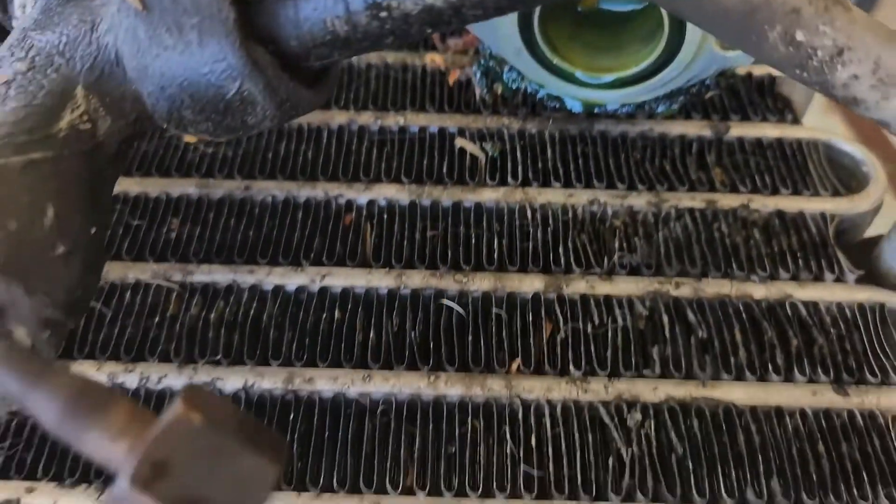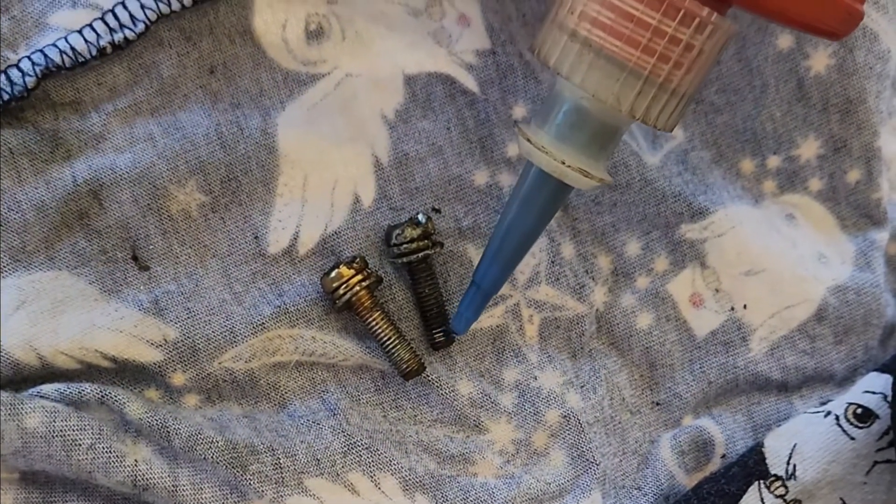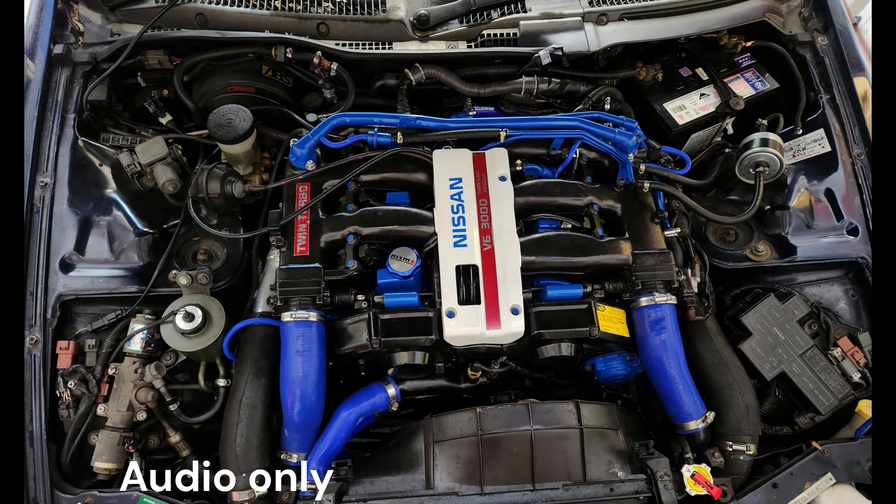Mine were pretty good, surprisingly. Make sure you put them back in the right direction. Because my bolts were so tight I did tap them out, and when I put the bolt back in I used a little bit of Loctite to keep them from coming loose, because you don't want leaks. Assembly is pretty much the reverse. Once you've got the suction throttle valve back on, try and put a new O-ring on it if you can get one — it might be a bit hard to find; I reused mine and it was fine, but that's not advice. Put the tar back on where you can — it's a pretty good insulator. Just drop the evaporator back in, make sure you reconnect the fluid drain hose or you might find you have wet feet. Try and get the tubes to go nicely back through the firewall and reattach the rubber and the two lines — new O-rings for them as well if you can. Then have it gassed up by a qualified technician or garage that can test it for you, and hopefully it fixes your problem.